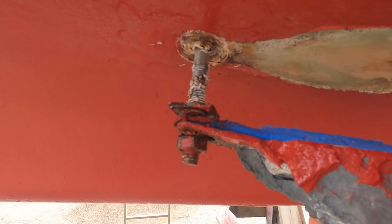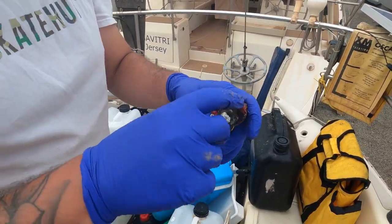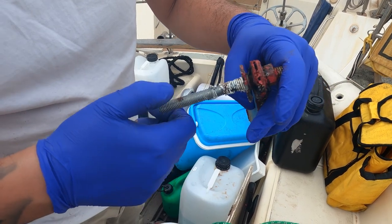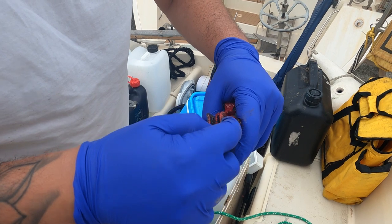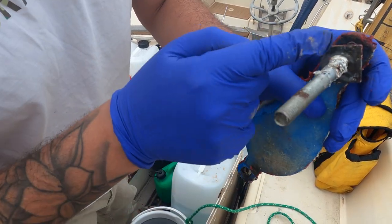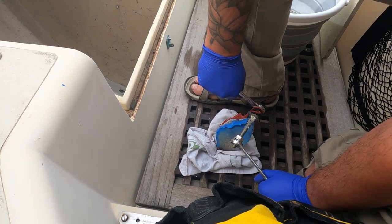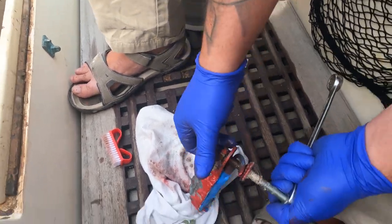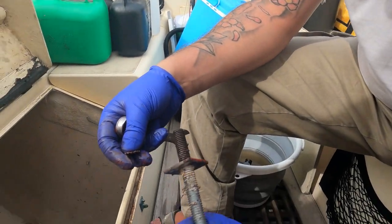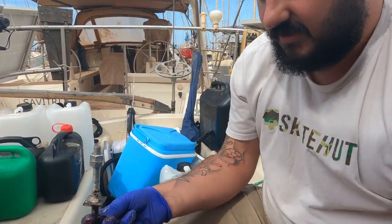It's coming out - let's see what we're working with. The bolt seems to be bonded on here. Now that we've got a bit of clean access, we'll try to get something to grip on it. It's much easier now it's out of the boat. We're also going to have to re-bed this plate because it was spinning - we couldn't have left it in anyway. We think we're making some progress... got it! That was so difficult.